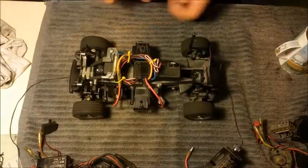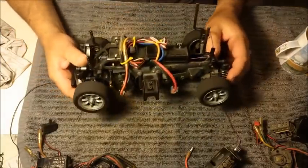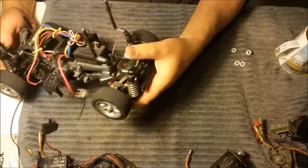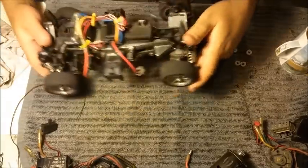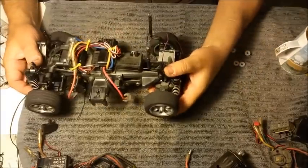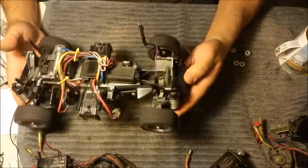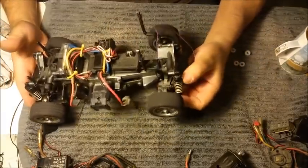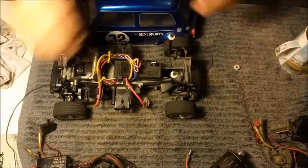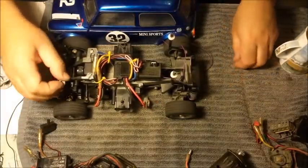The one thing that I'm a bit bemused by, I guess, is it's got oil-filled shocks in the front, and you've got these things at the back, which are just those rubbish pogo sticks, I don't know what you call them. That's likely to skip around. I would have thought, and the spring rate's very, very hard, I would have thought the best thing, as in a real vehicle, is using soft springs with a sway bar. So anyway, I'm just going to pop this back on and we'll talk about the other stuff.